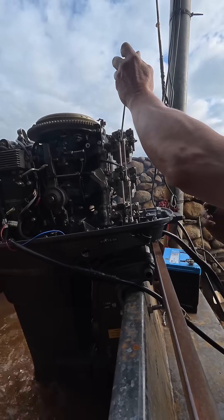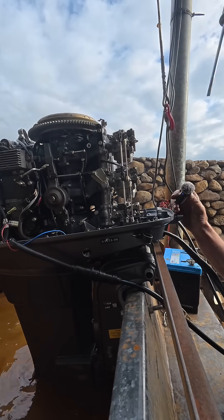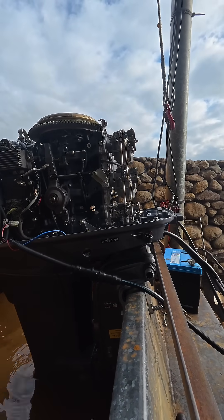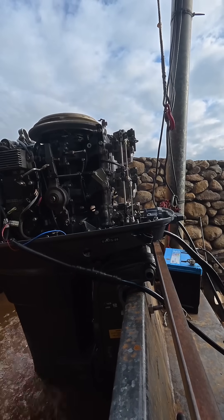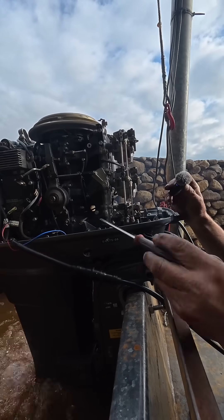Let's speed up a little bit for starters. We'll give it half a turn on the tick over speed — we'll do that just so we can keep it running while we're setting the mixture up.